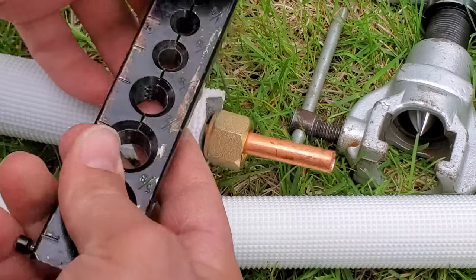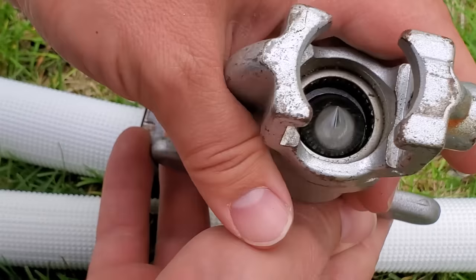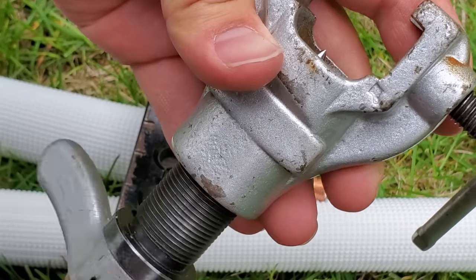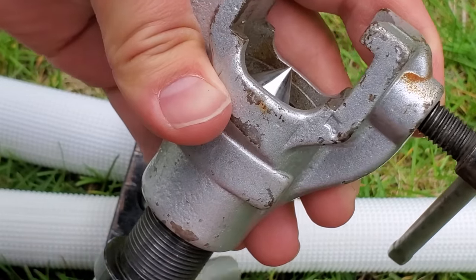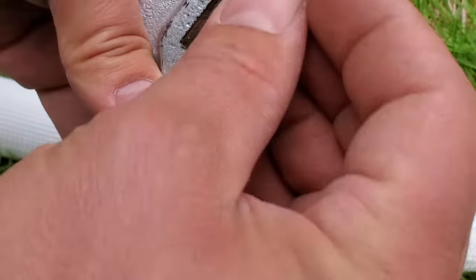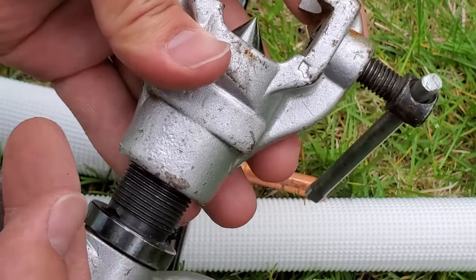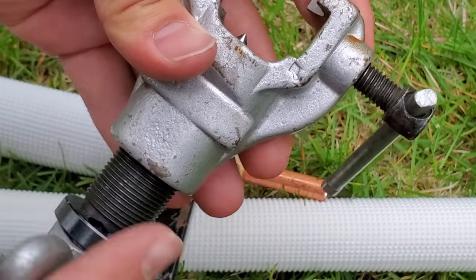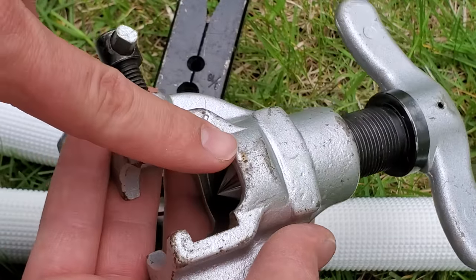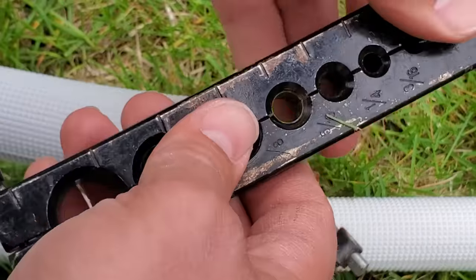The flaring tool we're going to be using is an eccentric flaring tool. This type of flaring tool basically has a rotational motion that goes around and presses the flare into the die in a circular motion — instead of just pushing it out directly with the cone, it kind of rolls it out into the die. It tends to do a much better job at making a nice, clean inner surface than a standard flaring tool will. I'd recommend picking up one of these; I'll put a link in the description to this tool as well as any other tools related to this process.